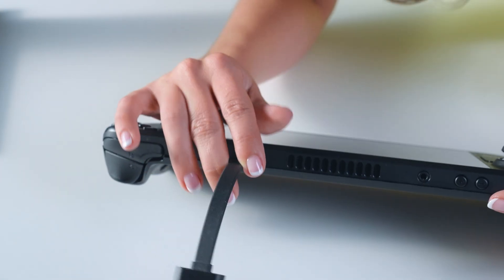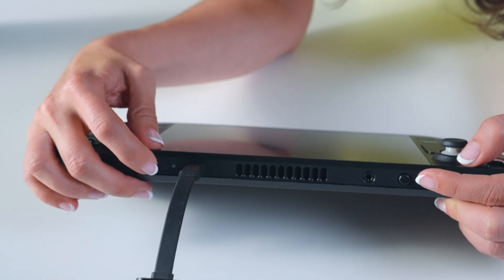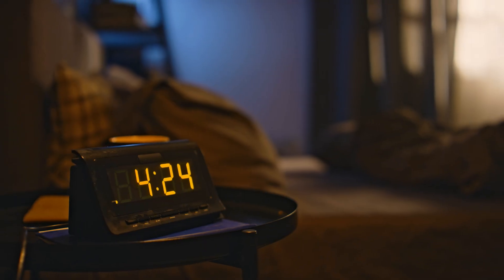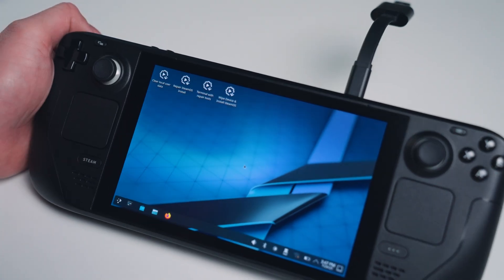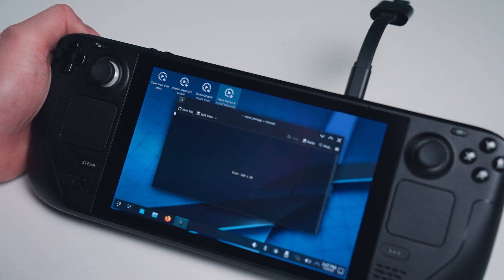Once complete, plug the flash drive into your Steam Deck. Start your Steam Deck holding the lower volume button and the power button. You should hear a chime, and if the boot drive is working, you can choose to boot — this part usually takes a while, so be prepared to wait as much as half an hour. Any longer, and you might want to reboot to Boot Manager and try again. A desktop OS should eventually load giving you four options — select Reimage Steam Deck, and you'll install the Steam OS on the new SSD.